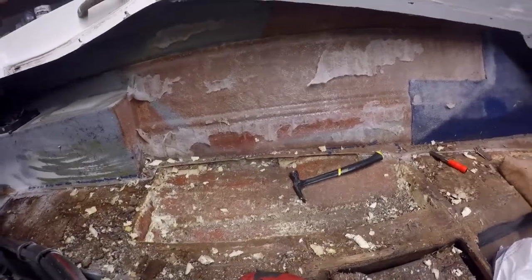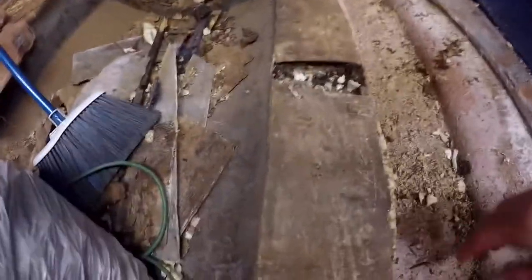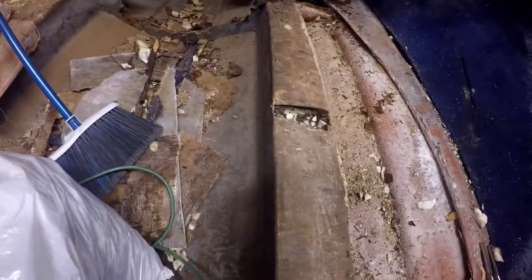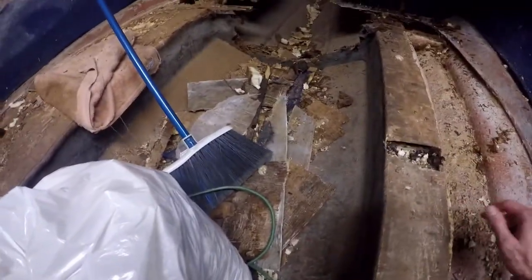There are a few reasons for that. If you look over here, this whole long beam right here — this is the stringer. This is one of the things with wood in it, and I cut a little hole here in the fiberglass skin where you can see there is rotting wood in the stringer, so we do need to remove it and replace it.